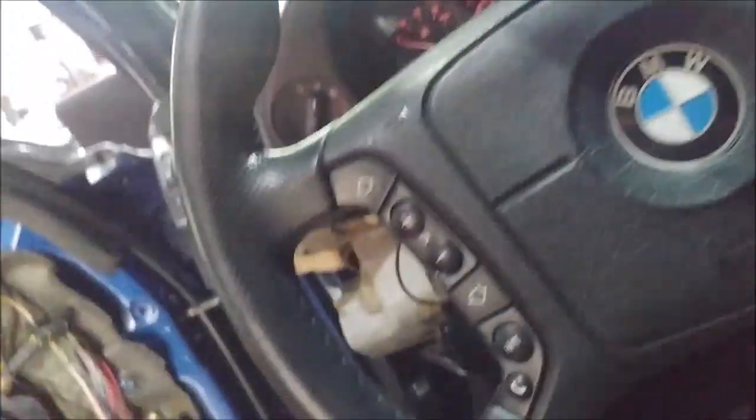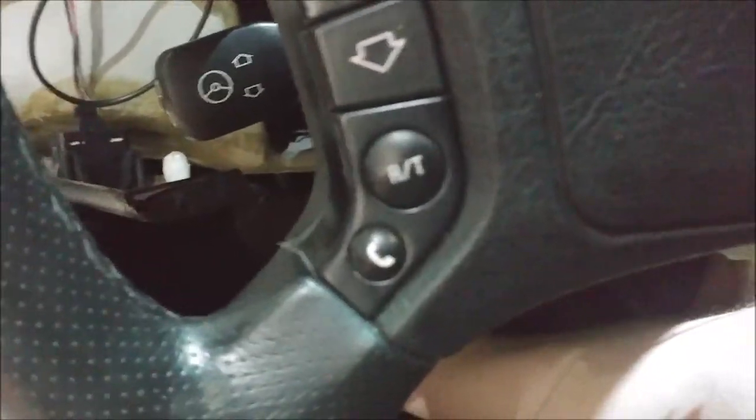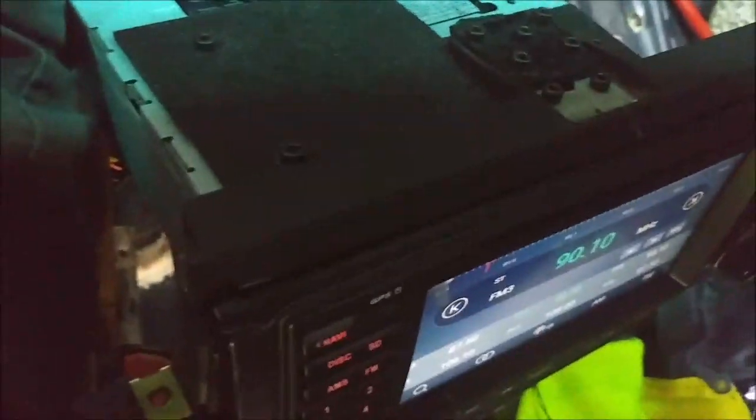And as a result of that, now the steering wheel controls still work. So again, volume down, volume up, and what's cool is RT, whatever the heck that meant, now switches modes on the unit. So you go between, whatever, music, video, basically it switches all the different modes. So volume works, skip works, and the phone button brings you to the phone. So that's everything working correctly with the brightness working correctly now that I've bypassed the CAN bus box, which again uses the iBus line, not CAN bus, but whatever. So it's all good.